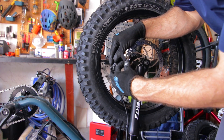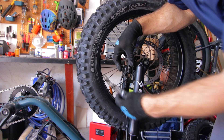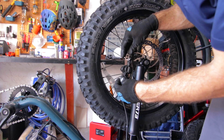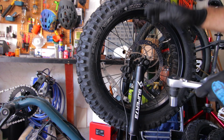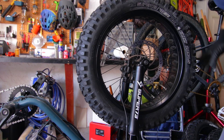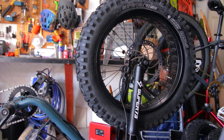I'm taking my little regulator piece and sliding it right there, then sliding the caliper over it. I've got my spacer piece up — it even shows me how it goes. Now it's positioned correctly. These bolts are actually two different sizes — your bigger one should be closer to the top of the bike, as that's where the thicker part of the spacer is. I hand-tighten that into place, then do the same with the other. I tighten down the bolts to make sure the wheel is in place and the rotor won't shift. Now I remove the regulator piece and everything should be good.